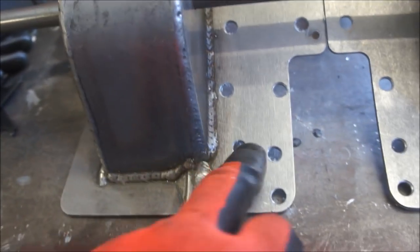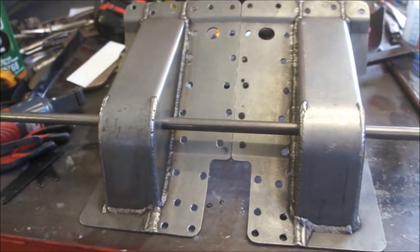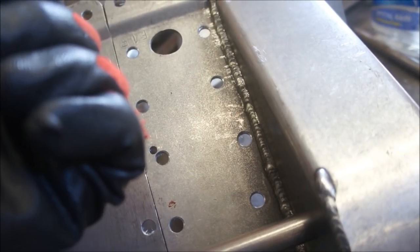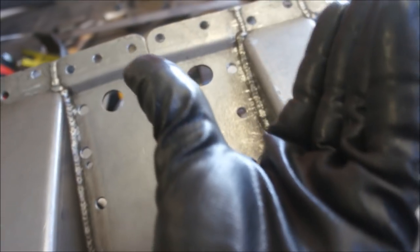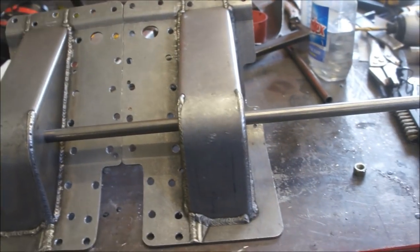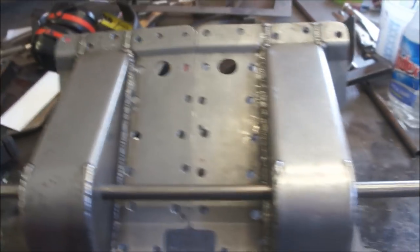And so then sandblast and get rid of any kind of residue. What I was going to say is I like to chamfer these edges because it actually gives you a little bit more into the material. If you think about it, it's almost like the V when you're welding something, you always want a V, and it's almost like a V shape in there. When you think about how that's going to fill in, it gives it more weld to fill into that surface area. So it's my opinion. And really, my opinion is the only one that counts. So there you have it.